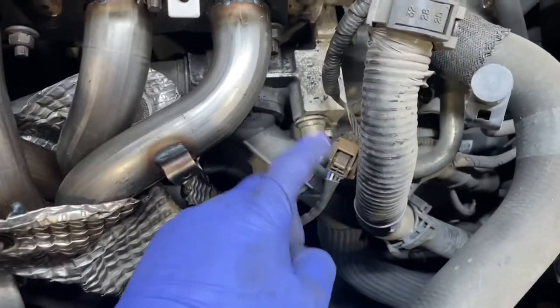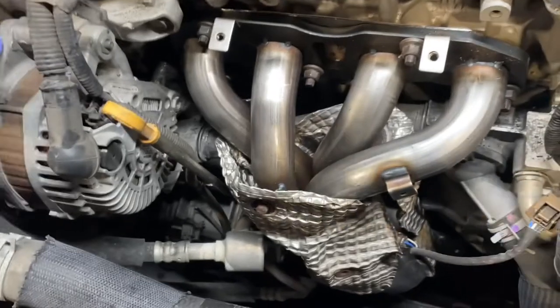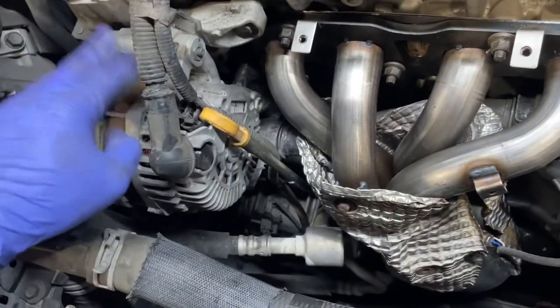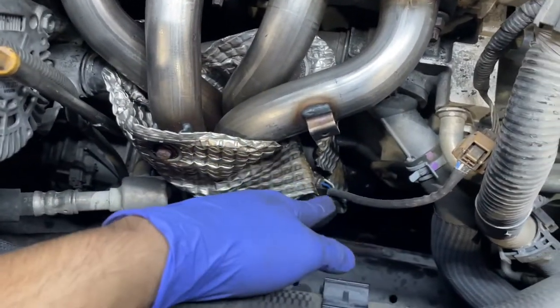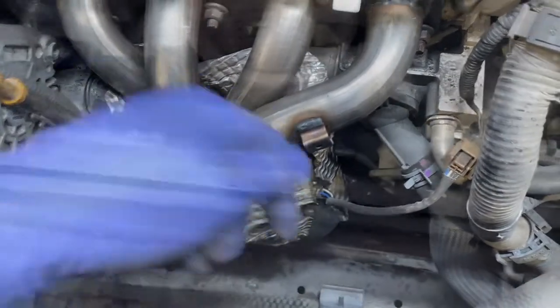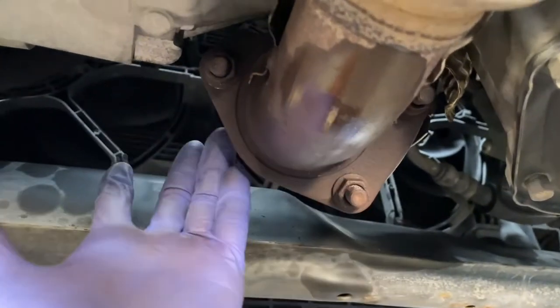I've already plugged in the O2 sensor. We're going to go ahead and put the alternator back in and tighten down the bolts, then go to the bottom to put the belt on and torque down the last three nuts on the downpipe for the cat. At the bottom, we put the studs in first - all three holes lined up - gasket and nuts in place, torqued down to 11 foot-pounds. The belt is already on as well, so we're good to go. Thanks for watching - please like and subscribe, more videos to come.